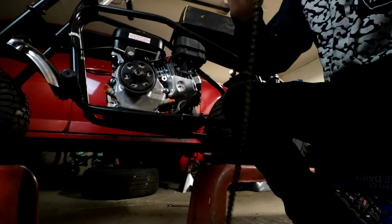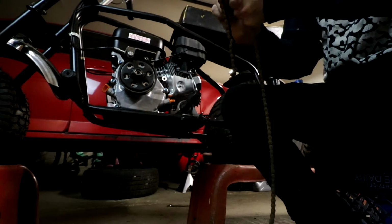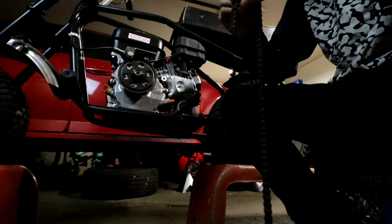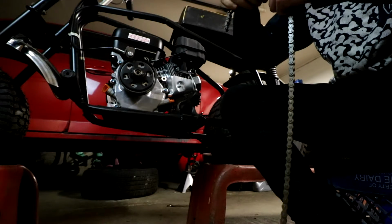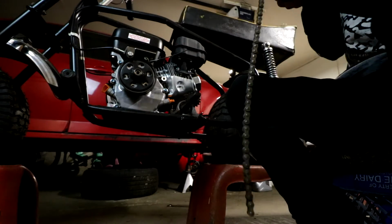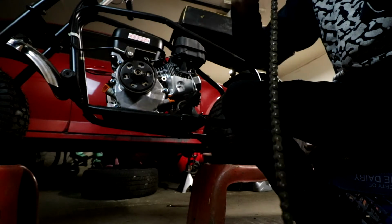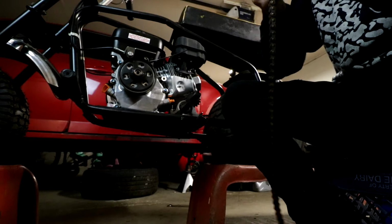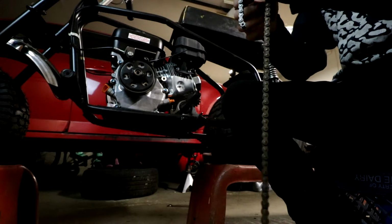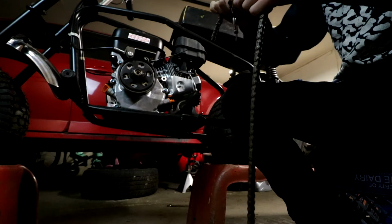Oh! We took her out all the way. So we're going for 28 links. The last chain was, what, 26? Is that what I said? Something like that, yeah, like 26. It's looking like it wants 27, and 28 might be a little bit too loose. But then again, who knows? We're going to go full for it just in case, because I don't want to take off too many extra and then have to figure out the pin situation and trying to put it back together. It's just a pain in the ass to put things back together than it is to take links off, obviously.